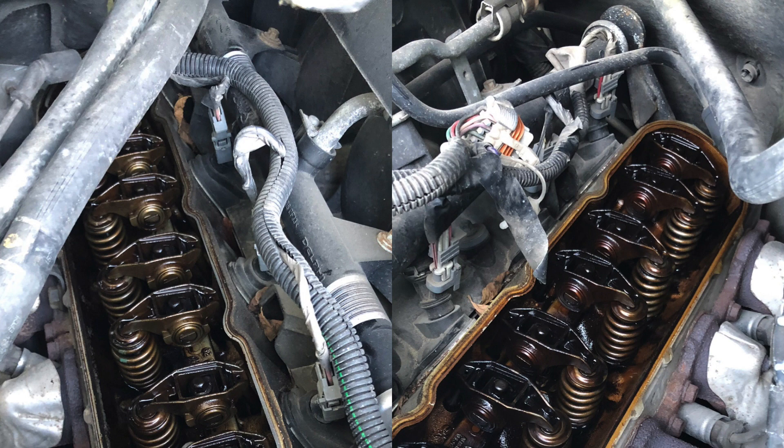That's what you'll want to look for when you're determining if you have a cracked cylinder head. I actually did pressure test the system and it actually tested out okay. So that alone doesn't really tell you the story — you really need to pull those valve covers off and have a look.